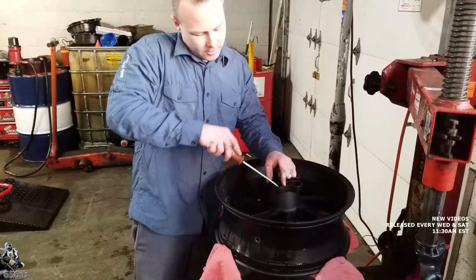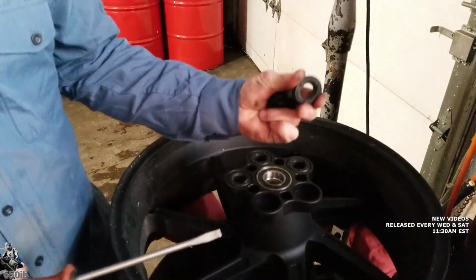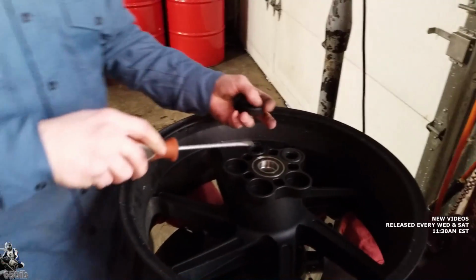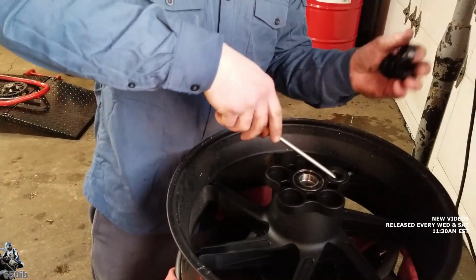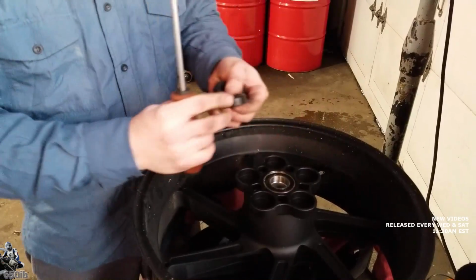Rubber pieces out of here. This is part of what's called a cush drive. It's where the sprocket slips into. You can see these are rubber and cushy. Yep. Hence the name cush drive. It keeps the shocks from all the power of the engine when it gets fed to the rear wheel by the chain. That way it doesn't just rip your wheel or twist the wheel. Oh, it beats these pieces up instead. So sometimes you actually have to replace these. It is a wear item.